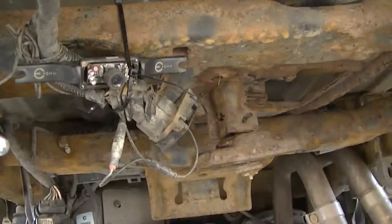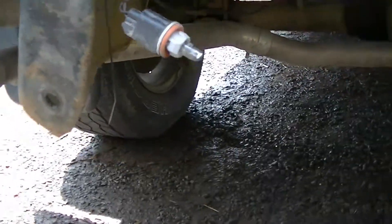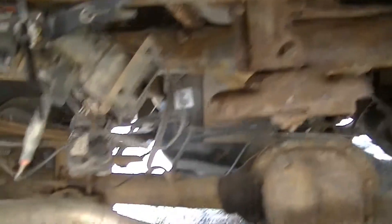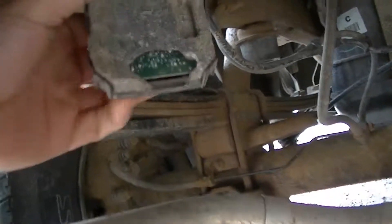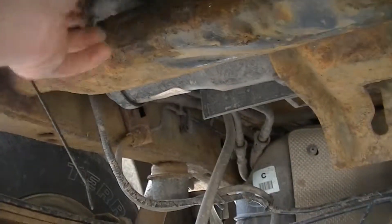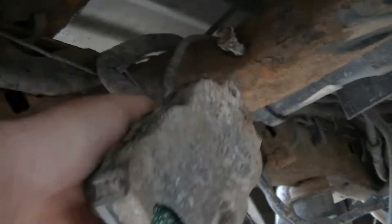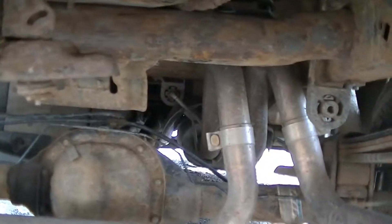I have the spare tire off. I got my Roush exhaust on here — nice exhaust note and everything. I also have my fuel pump controller module hanging there. If anybody owns a Ford truck and you've ever had a problem where you've hit water or driving in rain and the truck shuts down on you — check this thing out. That's exactly what happens. The aluminum casing rots away and then you get moisture in there, and it causes the system to short out and shut down. This thing is supposed to be mounted right here on that cross tube above the spare tire. Mine isn't mounted there anymore, so I'm going to have to replace that. I'm going to get some electrical epoxy and fill it with that solar panel sealant stuff, which will work just fine — I've used it before on electronics that were fully submerged in water for about 10 years and it still works fine.